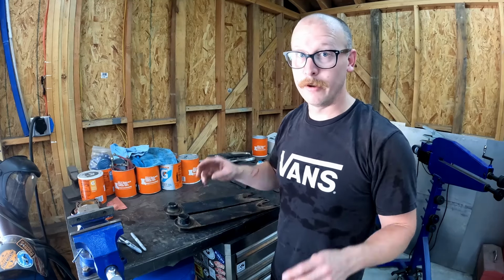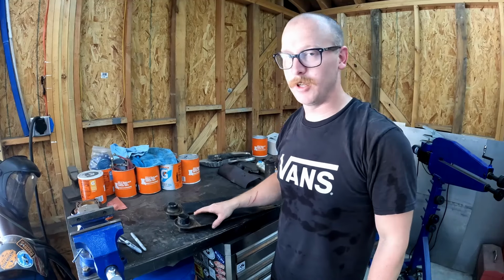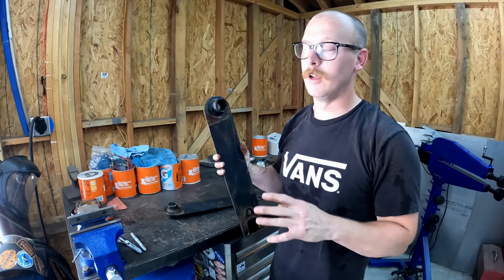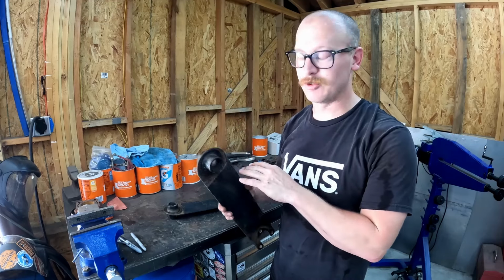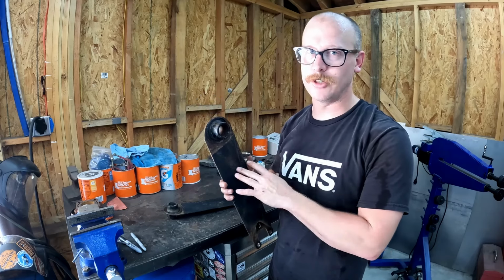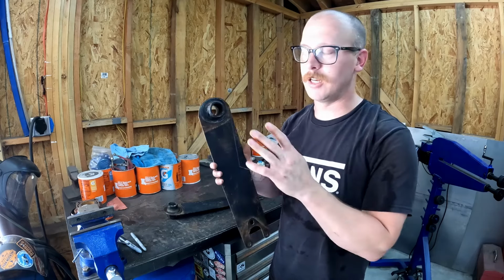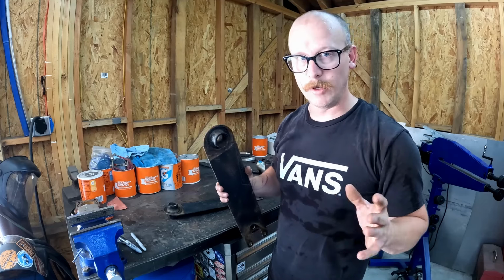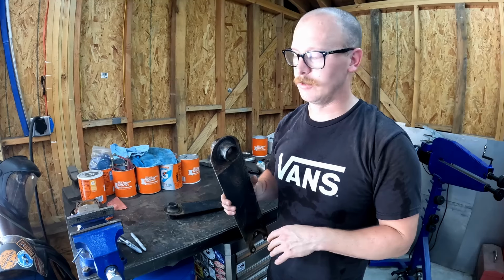And, you know, people will say, oh, it's not correct to notch them, because you're cutting into your spring plate, you're compromising it, whatever. If you want to ride low and have suspension travel, you have to put a notch in them. And people will say this is dangerous and you shouldn't do this, whatever. I put tens of thousands of miles on lowered Beetles with notched spring plates, no big deal. There's a million people out there doing the same thing.